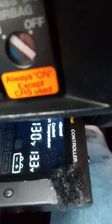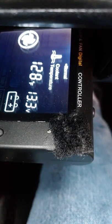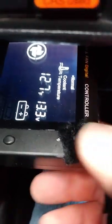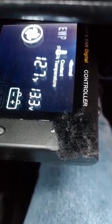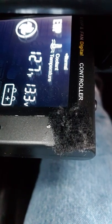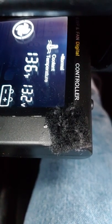This is the temperature of the water going into the radiator. Right now, the pump — when it blinks, it means it's in on-and-off mode. Because the temperature is far from the target, this being the target at 211, the pump is probably on 10 seconds, off 30 seconds, until it gets closer to the target.